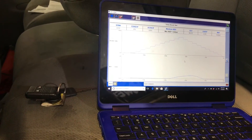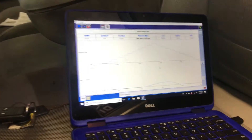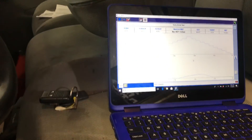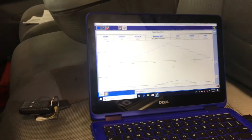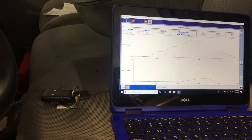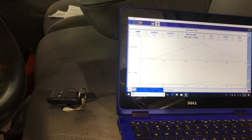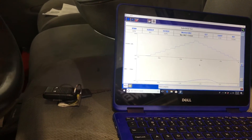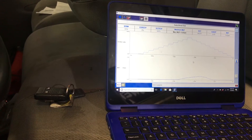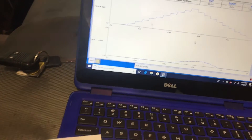That was probably the case on this one - I just didn't measure it. It's faster for me to yank the computer out and put a different one in to see if it works. But if you don't have spare parts laying around, follow those resistance tests. If the resistance is less than 5 ohms you need a new computer. If it's not, then you have an open circuit somewhere and need to fix your wiring. Another thing you can do is remove the actuator from the VGT and do what they call a VGT actuator valve clean, then retest.